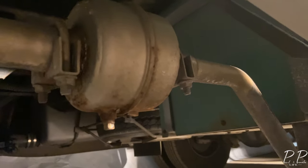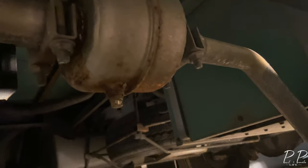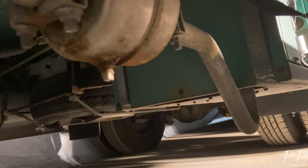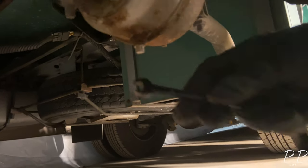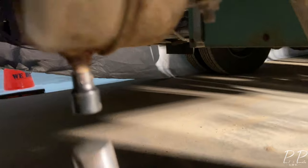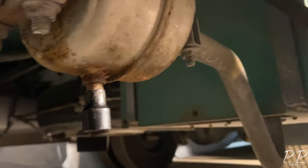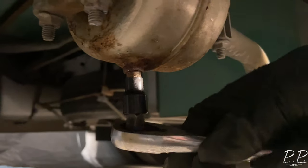Moving over to the spark arrester. We're going to come over to the canister — that little plug on the bottom we're going to thread out and take off, then move to step two. It seems the nut is a little stuck in there. I tried a 5/16ths socket and an 8mm wrench. I'm going to try a couple others to see if I can get it off. I took a socket and kind of worked it up on the nut — going to try to take this off. If it doesn't come off, I'll have to buy a new spark arrester.